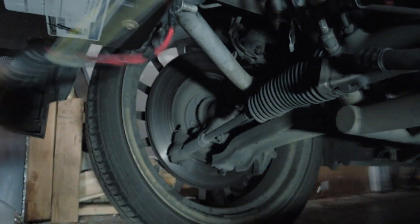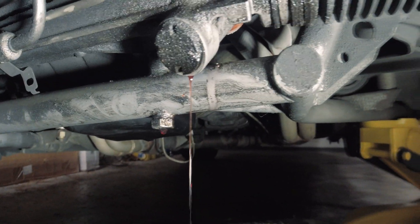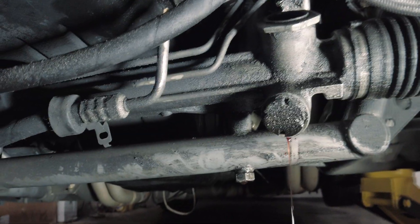There's the wires for the new rack already hanging. We're gonna disconnect this on both sides, take the bolt off — two bolts that hold this — and then go to town on it. Managed to get the power steering pump out, and the rack and everything. It was a pain in the butt. Here's what we got — let's swap this.